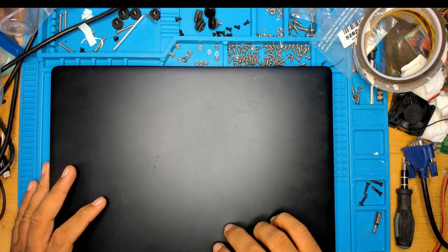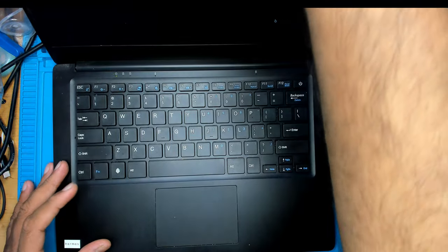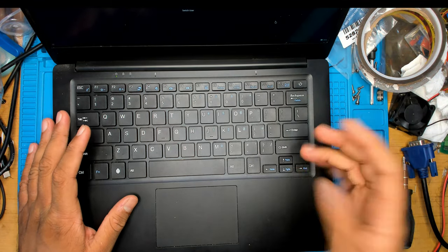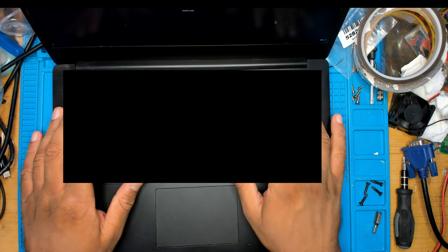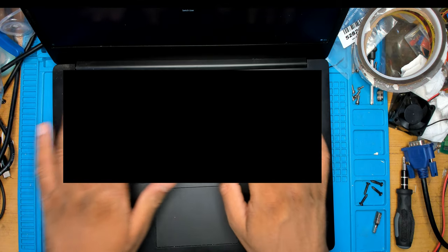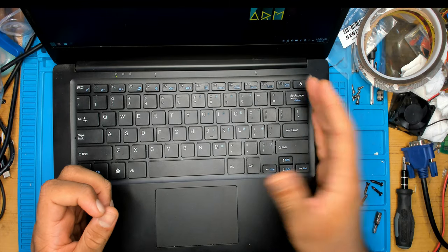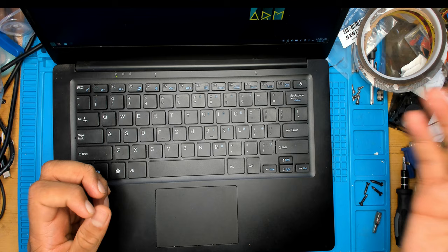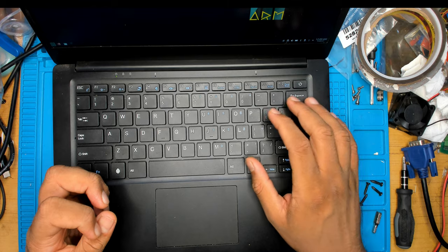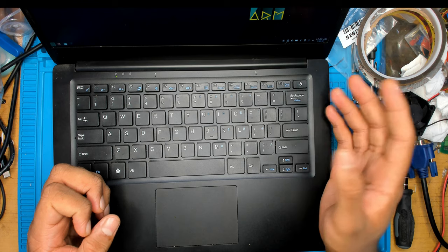So yeah, the one thing we need to do for that is to update the U-Boot on the SPI flash of this laptop. Pine64, for whatever reason, does not really provide proper U-Boot installed on the SPI flash, though they have the SPI flash built in. So install the SPI flash, and then it's pretty much plug in a USB drive with the AArch64 ISO for Fedora 34, and you can install it or just boot it directly off an SD card. So we'll do that as well.